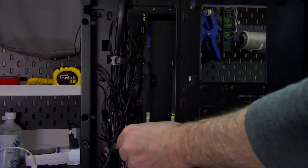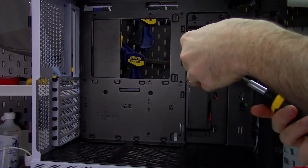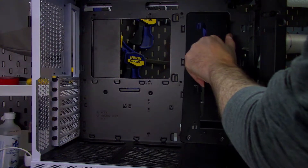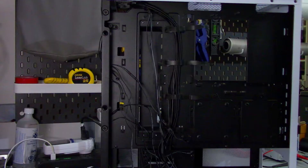The vertical cable cutout and cover can be flipped or removed. To do this, remove the Velcro straps on the back side of the motherboard tray, then undo two screws on the front side. To flip the cutout, rotate the cover 180 degrees and screw it back in. You don't have to have the cover installed, but without it you won't be able to use the Velcro straps as cable runs. There is 25mm of space behind the motherboard tray for cables.